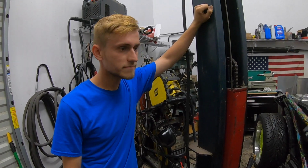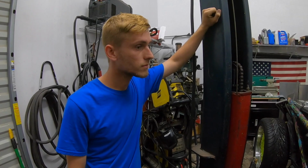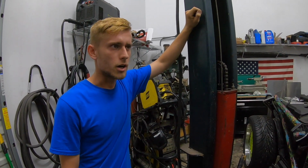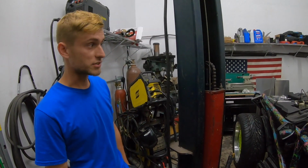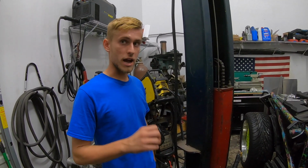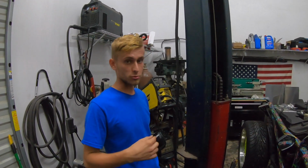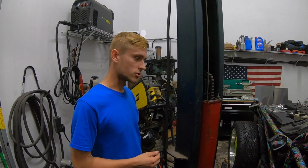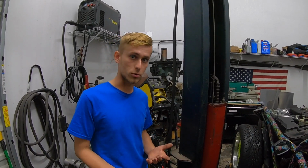Okay. And so you did that, and then you calibrated for our 980 cc injectors, which are huge compared to the 220 that was in it. 225. So the stock injectors were 225. Now we're running 980 cc injectors. So for the larger injectors, we don't have to pulse the injectors for as long, but we have to pulse the injectors longer for the ethanol fuel than for the gasoline. Okay. Because of the caloric value of ethanol, you need about 30% more fuel to make the same power.